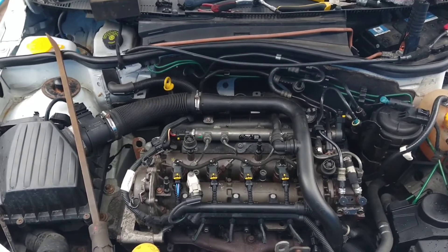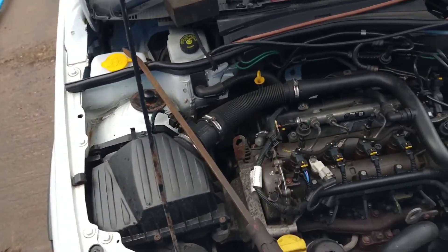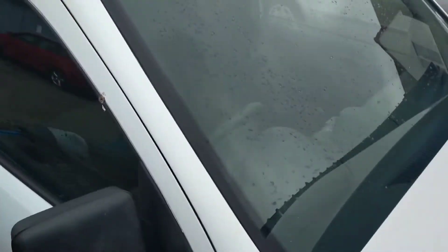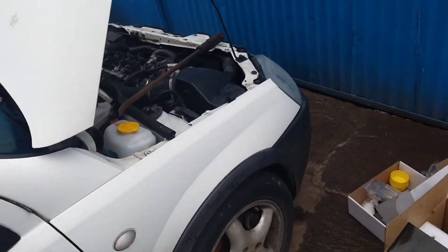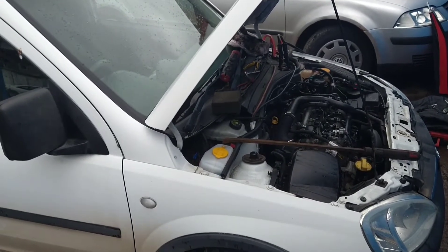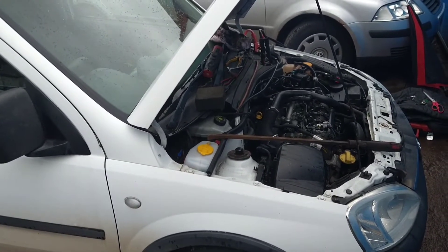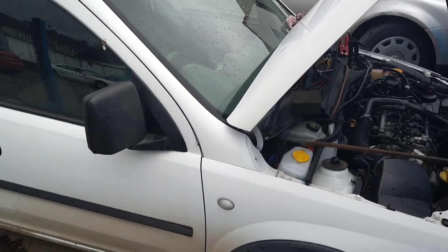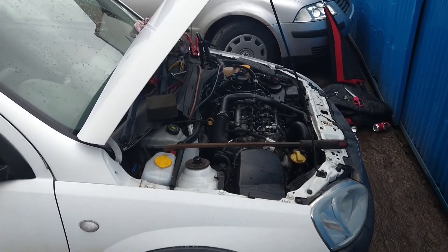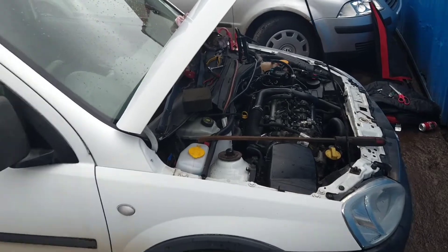Once we knew that the fuel was okay, I had a problem with the scan tool just updating the data — that was misleading. It was almost like I couldn't use that scan tool; it was that slow updating. I was thinking there was no fuel pressure, which is the same as the guy that looked at this before me. They fitted a high-pressure pump, done a leak-off test, and weren't quite sure where to go after that. Maybe their scan tool was showing zero pressure as well. But when I checked it with a voltmeter, I saw that there was pressure — so I knew everything up to the rail and the rail sealing was okay. This is fantastic that it's going.